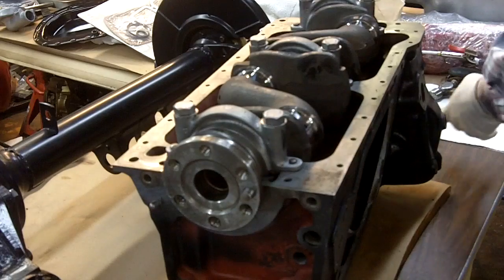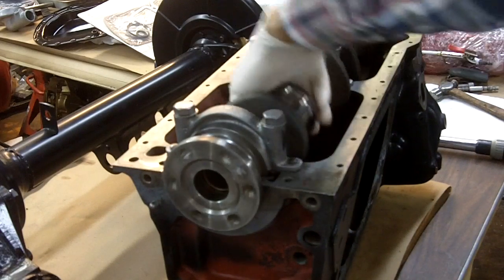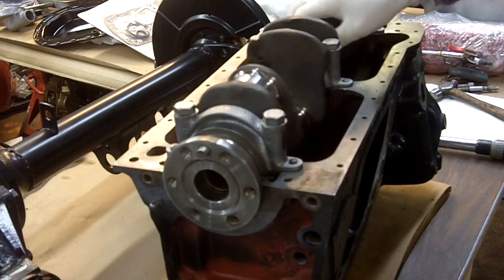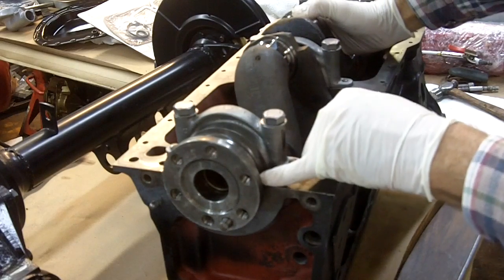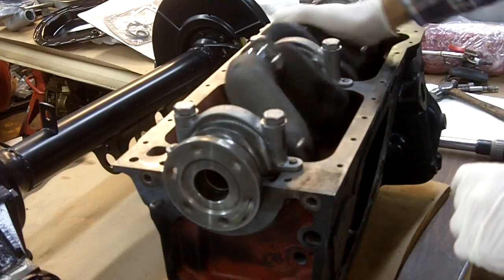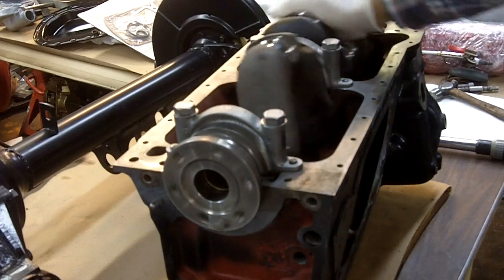Now we've got our torque, and that is an absolutely magnificent feeling crankshaft — absolutely smooth as glass. We don't want the rear main seal in here because we don't want any drag from the rear seal affecting our feel of the crankshaft in the main bearings. Just using 30-weight oil, that is absolutely magnificent.